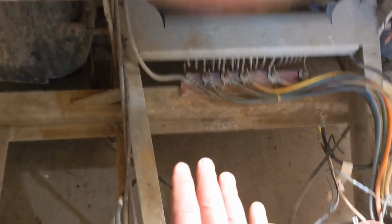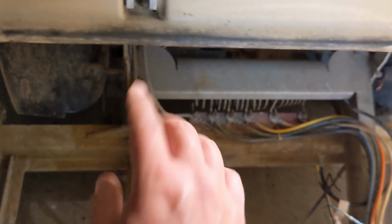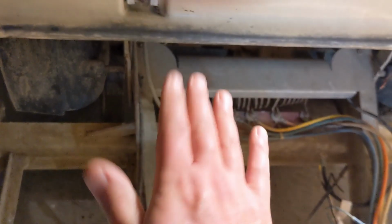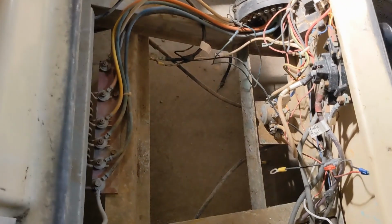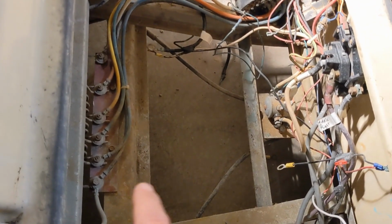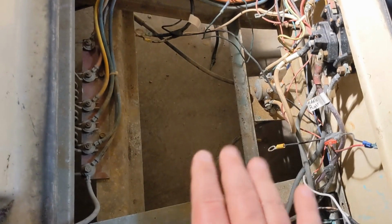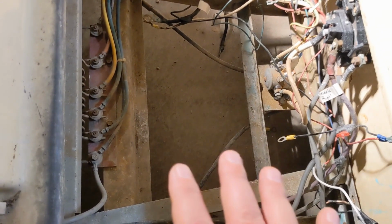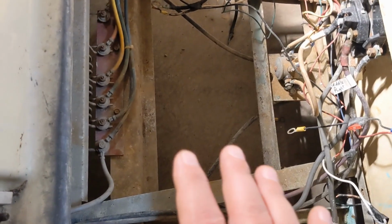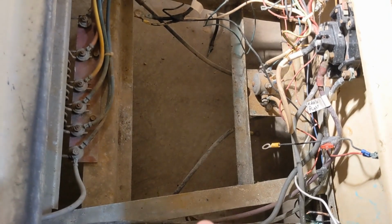so I think that's my best bet. And I measured the clearance from there to here, and it works. There's about a half inch difference, so that's fine. The seat will close and it's not going to rub. The only issue, a minor one, is that this is higher than that. So I'm going to have to do something to bump that up a bit so the battery's flat. That being said, officially lithium doesn't have to be dead flat. These aren't lead acid, but still, it would be nice if I could put something there and make it flat.